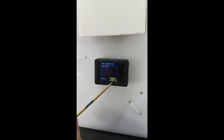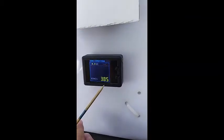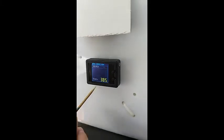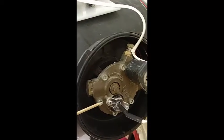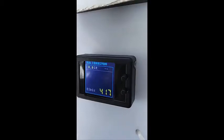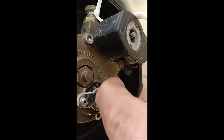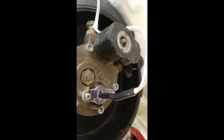We found the lower value on the screen, but we need to add an offset value. Our offset value must be between 70 and 100. The most important thing is we need to rotate our sensor anti-clockwise slowly — not clockwise, anti-clockwise. Now I am rotating the sensor and increasing the value by a minimum of 70 more. I think this is enough. Now I can tighten the sensor.